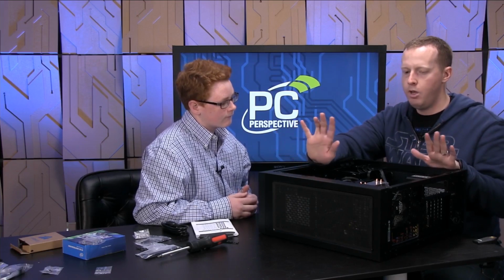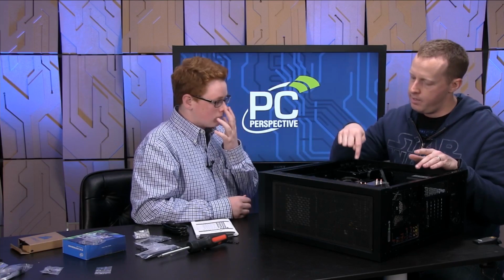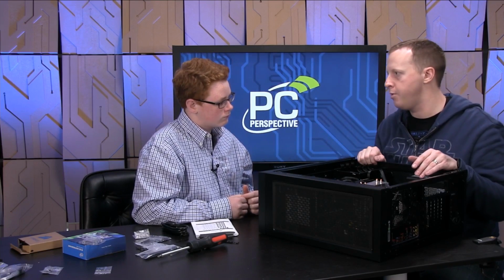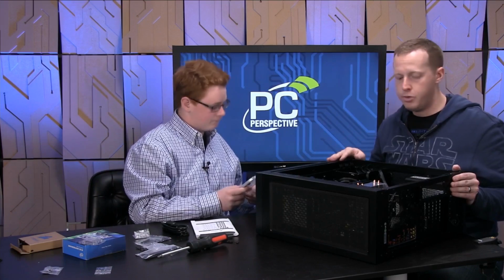We're still missing one last step, I think, before we can get into installing software. And that's we need to connect the SSD, the hard drive, and your optical drive to the motherboard. So if you remember those 2 other packages I had you take out of the motherboard box, those are SATA cables. So go ahead and open up those packages for me.